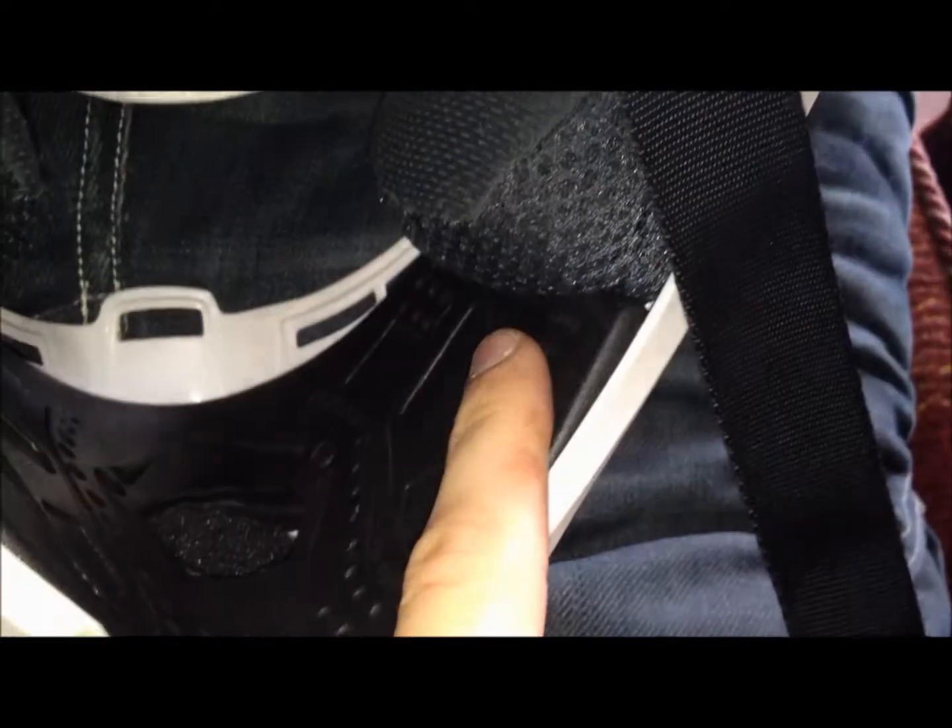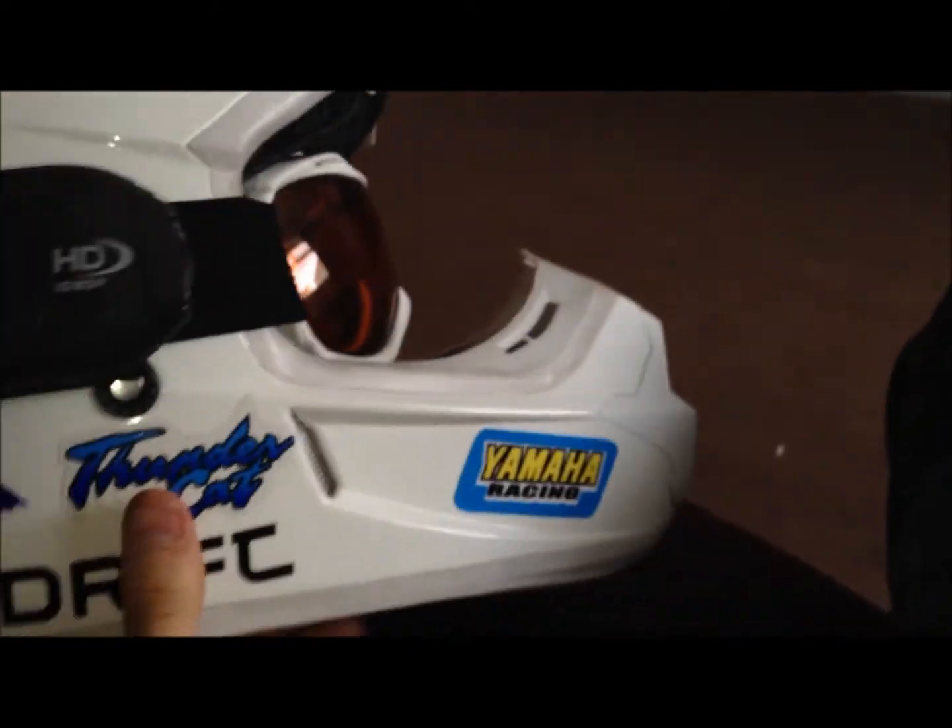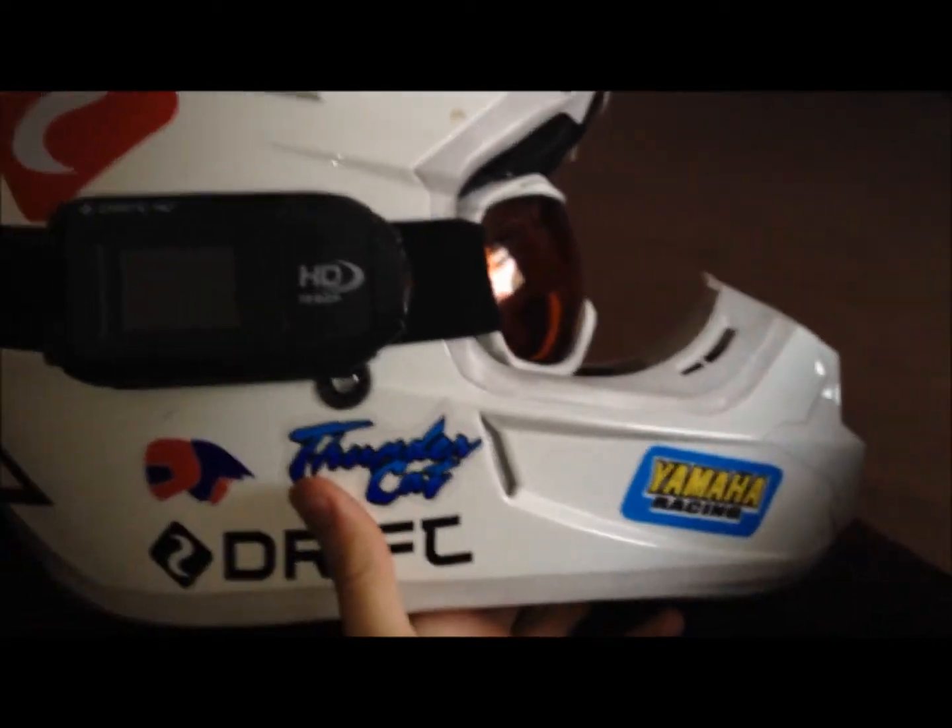The reason I put it in my cheek piece is because at first I had it at the front, and then obviously you've got wind coming through your grills so you get a lot of interference. I tried putting it at the side, but then there's a vent there. I tried the top — grills again. I tried the back — grills there too, and you can't hear me as well. So what you need to do is find somewhere where the wind can't get it, cut a hole into your cheek piece, push the microphone through it, and then you won't have any wind interference. If you've got an open-face helmet like this, you need to do that or you will get wind interference.